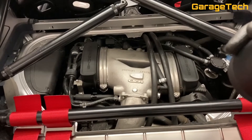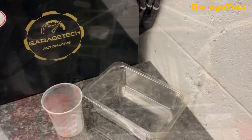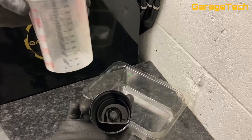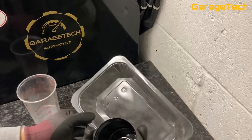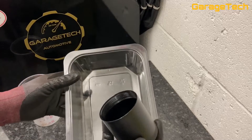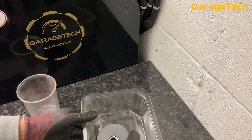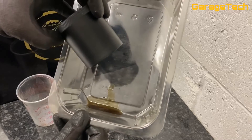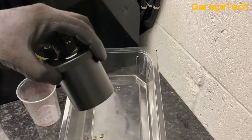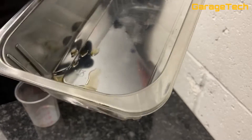So let's go put you over here and see what it looks like when I pour it out. Just come over to my bench to have a look. I was going to pour it into something like this to measure how much I'm getting out, but actually it's so little in there, there's not really any point. It's probably not even five to ten mils worth. So I'm going to pour it out just really so I can see the colour of the oil that's coming out of it. You can see that's what I've just poured out. Obviously bearing in mind I changed my oil right before fitting this catch tank, so the oil's fresh. And you can see the oil is actually really clean.